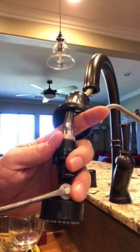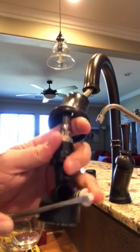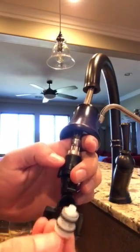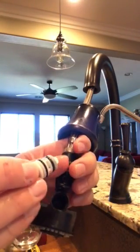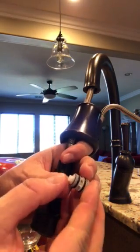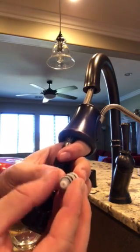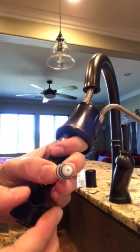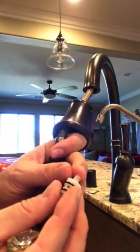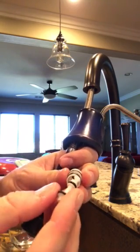So I just got a screw behind this little head, and it pulls. If you pull on it, it pulls right out. So this is the plunger assembly that controls your switch. It's got a bunch of O-rings on it. The only one that matters, that gunks this whole thing up, is inside. So once you take it apart, you'll see this is 2 plastic pieces with O-rings on it. You take this end and push down to advance it down, and the centerpiece comes out.